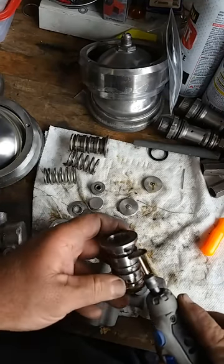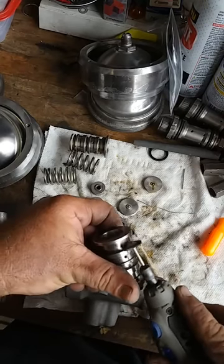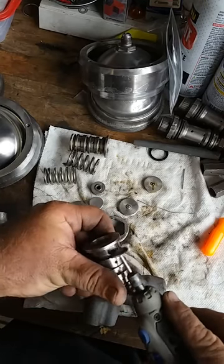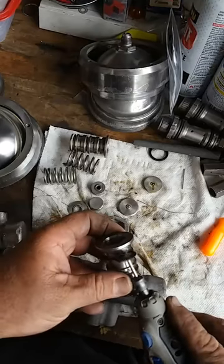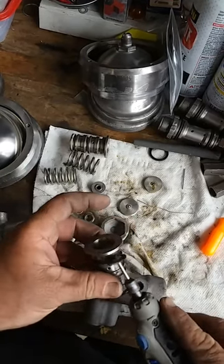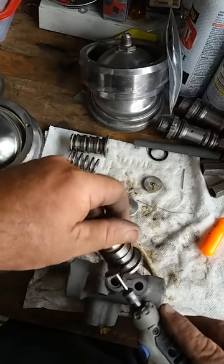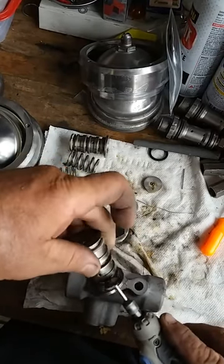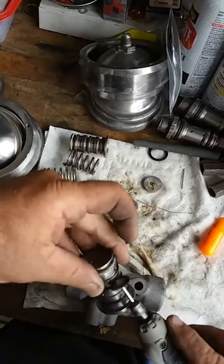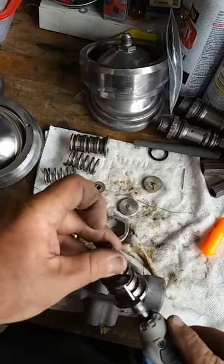Nobody that I know of is doing this the way Mr. Sunshine Rolls-Royce technician Eddie does it. But when we're done with them, they're going to last a long, long time, to say the very least. So we're going to clean them on both sides, get them down in the groove so that the O-ring will sit down there nice and easy. Just like that.